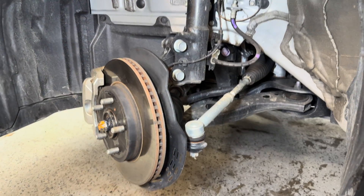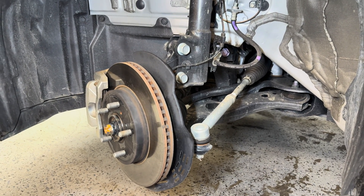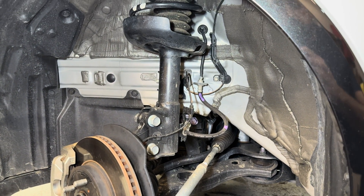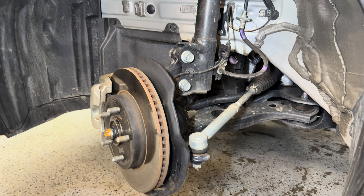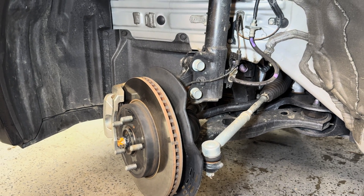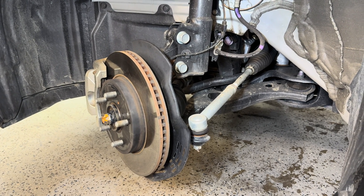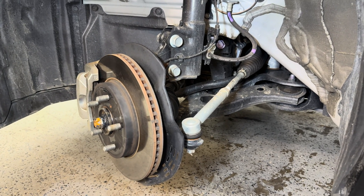Now that we've seen the front suspension on the Prius, I can say there are a lot of opportunities for performance upgrades. With how some of these components look, I wouldn't be surprised if there are parts interchangeable from the Toyota parts catalog — starting with that upright assembly, which looks very similar to things I've seen on the Camry or even the GR Corolla, opening up options for components that are already on the market.